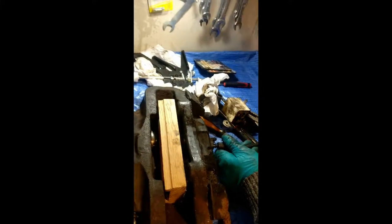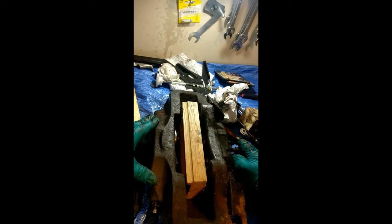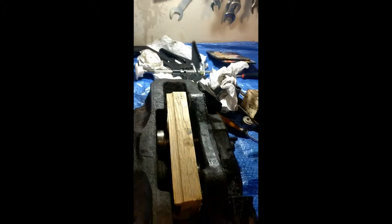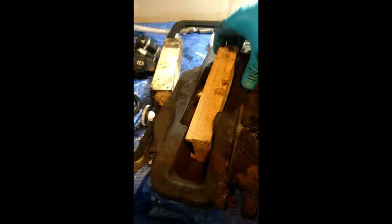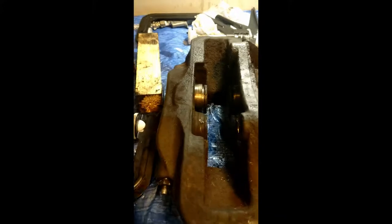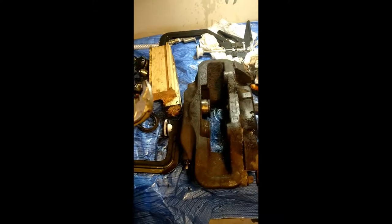Again, we're using the mobile compressor, but it should be enough. Put the wee button down. That's them all out. So if you remove this bit of wood now, you can see all the four pistons are out a quarter of the way, and at that point we can grab them all and take them all out. So we can, which we'll do now.